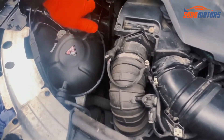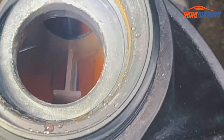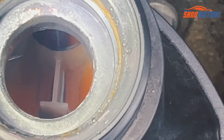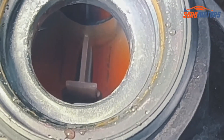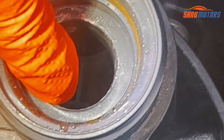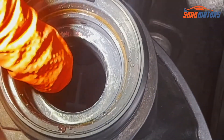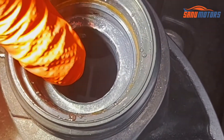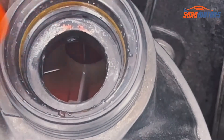This symbol is for the radiator — you can add radiator coolant to this component. If you want to check the level, you need to open this lid. You can see inside a black and white color joint — that's the maximum level. If you can cover this edge with the coolant, that's the correct level.